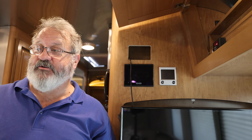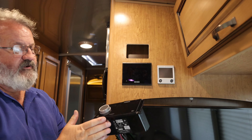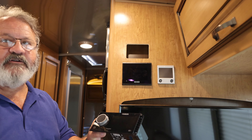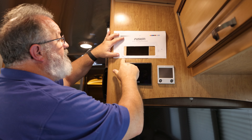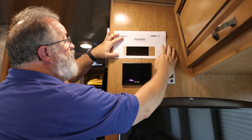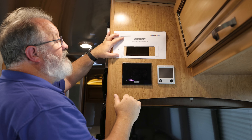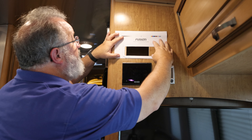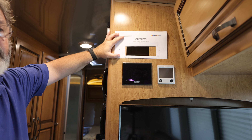One of the first issues we have to deal with is the width of the slot. The slot that's there is big enough to basically swallow the entire radio, so the lower and upper edges are going to have to go right exactly on the lower and upper edges of the face plate. We're going to have to cut out a notch here and a notch here. I have a template — I've printed it out and cut a line that has to line up with the bottom of the slot and be parallel with this, because I can't have these two devices cockeyed. We're going to tape it using painter's tape, line it up exactly where it needs to go, take a marker, draw our line, and then cut it.